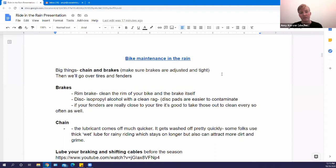If you have disc brakes, discs are easier to get contaminated, and then they won't be effective at stopping. When you clean your discs, use isopropyl alcohol to get them really clean, because even the oils on your fingers can contaminate them. For both brake types, just make sure they're clean and really dialed in.